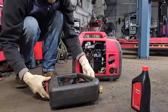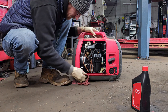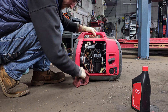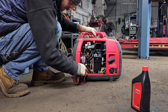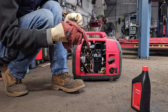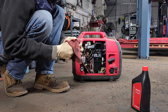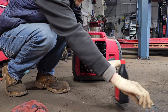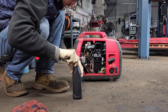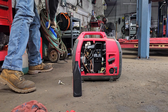About done draining — time to clean up that mess. Clean this off a little bit, make sure none of that old nasty oil is floating around. Clean off your dipstick. Then grab yourself a fresh quart of oil.